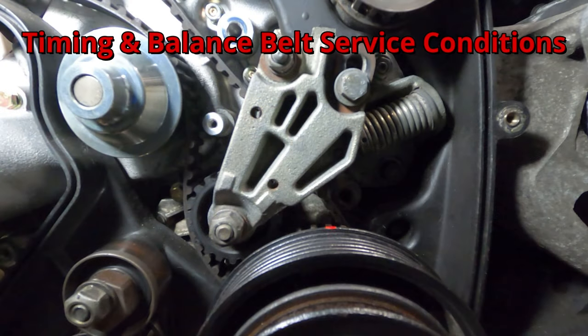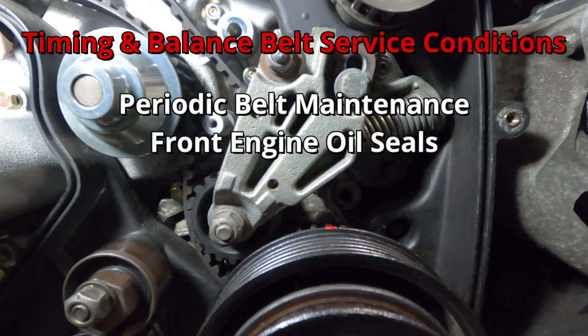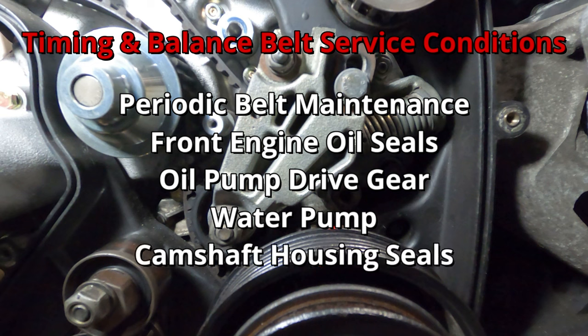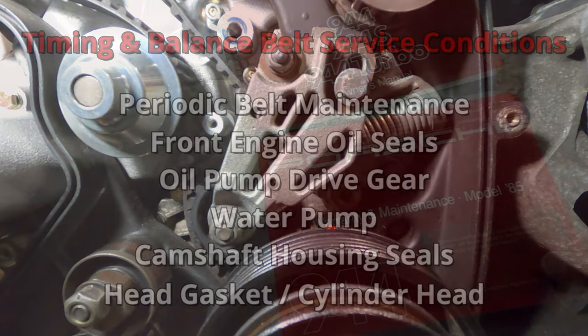In addition to the recommended belt maintenance, the drive belts also need to be removed for the following service items: front oil seal replacement, whether that be crankshaft or balance shaft, oil pump drive gear replacement, water pump replacement, camshaft housing seal replacement, head gasket replacement, or any work performed on the cylinder head.